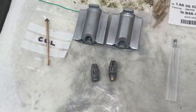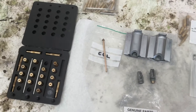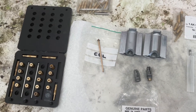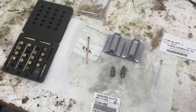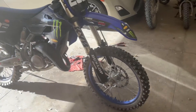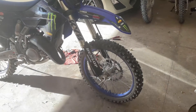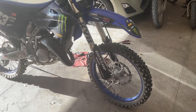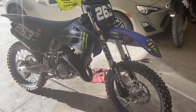So those are the jetting specs we've tested. We've had this bike for a while and tried a lot of different things. The CCL needle and number six slide, if you can get them, are great — the bike runs great. I'm going to throw the FMF pipe and silencer back on and maybe go up one on the main. It's a fun bike once you get that jetting set up correctly. Thanks.